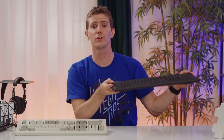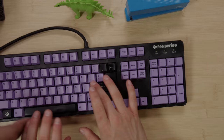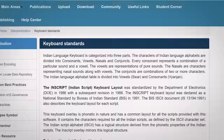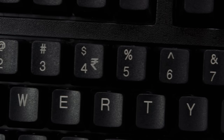The next thing that a lot of TVS Gold users talk about is the layout. At first glance it looks like the same North American key layout pioneered by the Model M, but it actually has a bigger enter key and a smaller backspace key — that second one in particular can be really frustrating if you're not used to it. You shouldn't confuse this with the European ISO layout, which also has a tall enter key. This is actually a special layout called InScript, ratified by the government of India in the early 1990s and designed to work with 12 different Indian scripts. This keyboard was also the first ever to have the Indian rupee sign printed on the legend, though you may need to go through some extra steps to actually get it working.